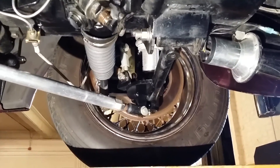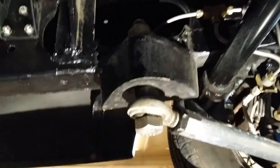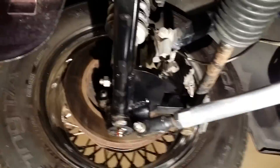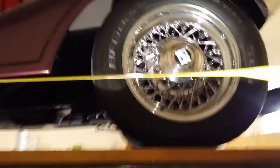The client's concern was how balanced the front end was and what the wheelbase looked like. For starters, all the components and reinforcements are very heavy duty. These lower billet arms were made and they're adjustable, so there's some adjustment in what the suspension can do. There's a little room in this lower control arm bushing — same thing applies on the other side. The look and stance of the car looks good on the rack.